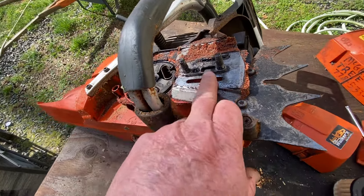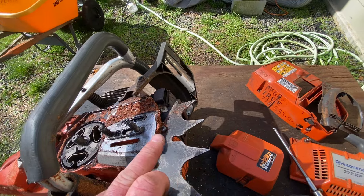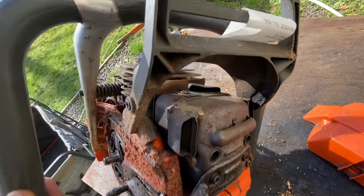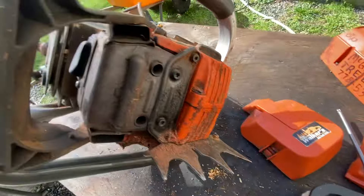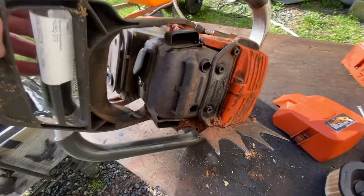He's got the steel bar on here with the steel adapter. You would have been running one more driver in the chain, or you simply groove the bar out so it slides back farther — I've showed you that on a previous video. He's got the caps and screens like we use here in BC for forest regulation. They work fine and give you just over half a horsepower gain with just this muffler mod.